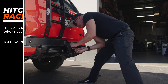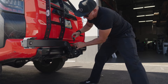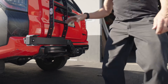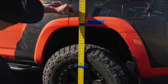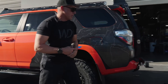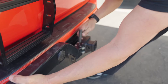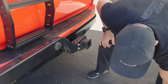You can assemble this whole thing on the ground, but I find it easier to assemble it on the vehicle, especially if you're doing this all by yourself. Up here at the top we've got a locking allen. I tighten this down and wiggle the arm until I get all the movement out of it. Just from adding these two pieces, let's see if we've got a difference in height. We're still right there — just starting to drop down, but as we continue to add weight we'll see this fluctuate. It's all tight and snug. I'm shaking it now and it's literally moving the car, so that's nice and tight.